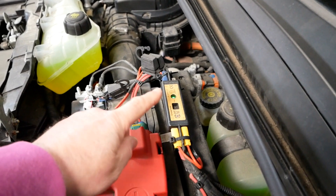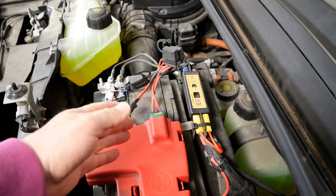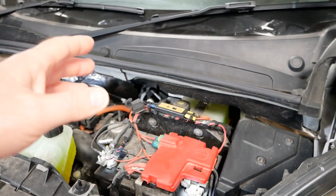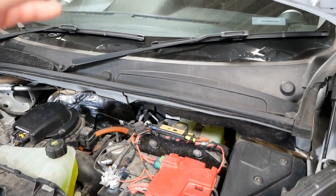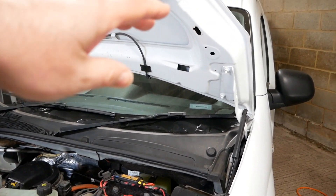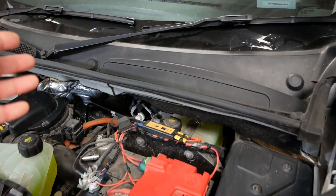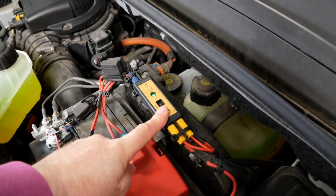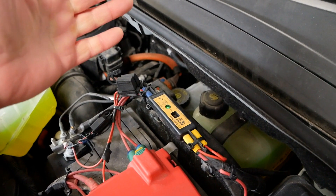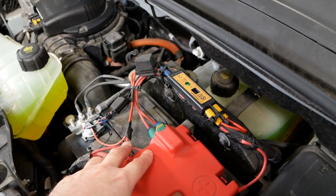These are programmable, but as standard they will cut the load off when it gets to 11 and a half volts, which still leaves you enough charge in the battery to start the vehicle. That's very handy if you've got something running all the time like a fridge or maybe a light bar. I think that's exactly what this vehicle had, because it did have marks in the roof where a roof rail was on the back. So I'm assuming this vehicle had a light bar flashing, and you put this device on so if you leave your light bar running all day it's quite safe — as soon as the battery gets to 11 and a half volts, this will turn off the light bar so you're not left caught short.